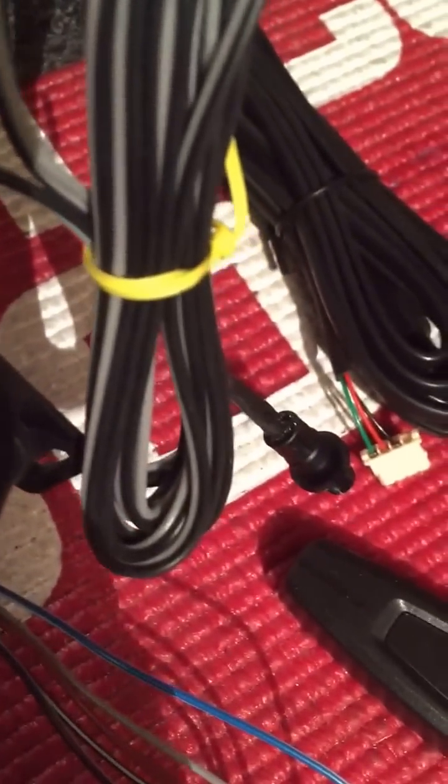This red — this is the red LED. Tied to that is going to be your push button here. This is how you're going to access your menu features. It's going to be a combination of key turns with the ignition as well as pushing and or push-and-hold. This button is going to correspond to this LED flashing and give you a number of light-ups so you can follow along as far as which selection you're in in the menu, as well as what option you're choosing.